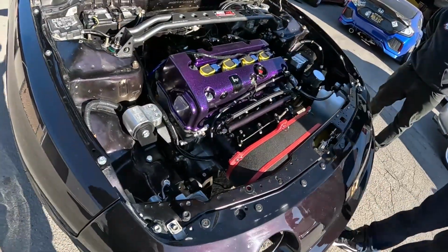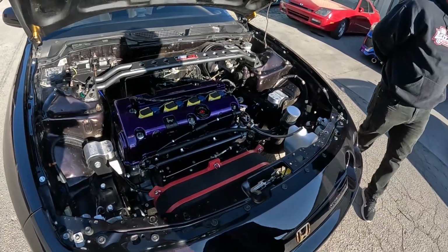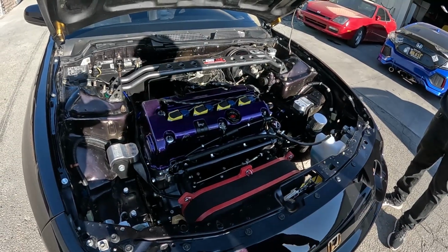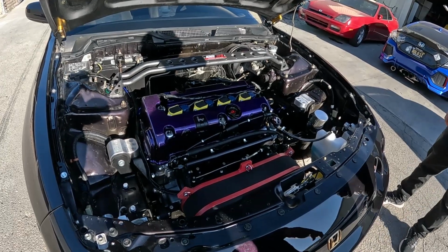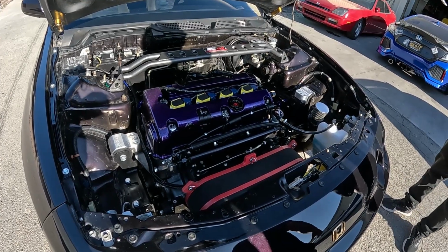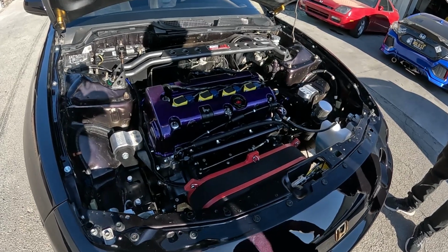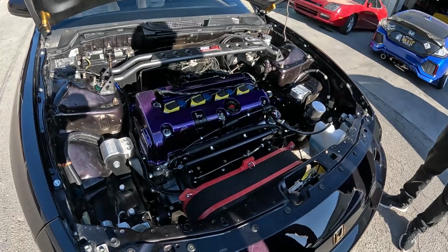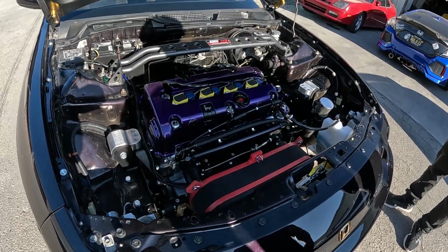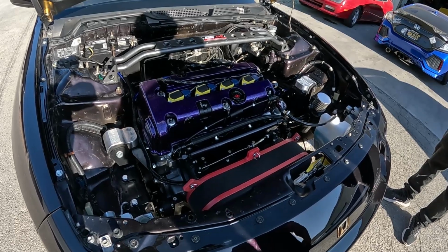Gotcha. So I'll tell my secrets about the tranny. It's got a 5.1 final drive. It's got a MFactory 3 LSD, the race edition. I wanted to give that one a shot. And it's got your carbon synchros. Replace the bearings that need to be replaced. Plus it has a driver mod, which is important. Clutch, it's got a stage 5 clutch, unsprung 6-puck. You got a Lion chromoly flywheel and ARP flywheel bolts. Make sure to Loctite them.